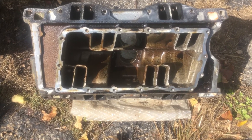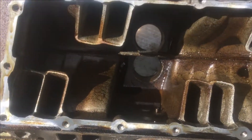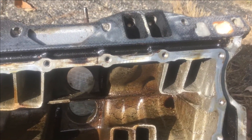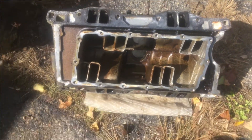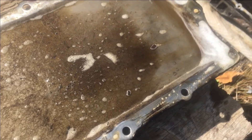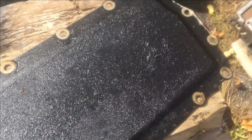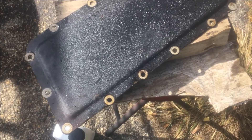We took the plate off the bottom of the intake manifold and you can see all the oil in there — the plate was leaking. It looks like someone had put a FelPro gasket on it; I don't think stock they came with FelPro gaskets. Even with that it was still leaking. We sprayed it to degrease a little bit. The bottom was horrific, coated with baked-on oil. We're going to make a replacement out of aluminum, so there's no real reason to stick this in the tank.